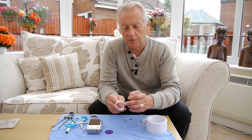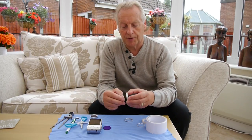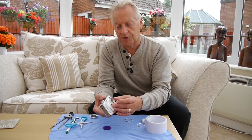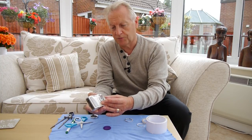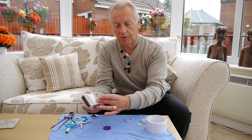Once you remove the locking ring and the filter itself, you now have the component which will glue with double-sided tape to the front surface of the lens. This gives you a system which will hold other 37mm filters, or a 37mm to 49mm or 52mm step-up ring — whatever size of filter you want to put on the camera.